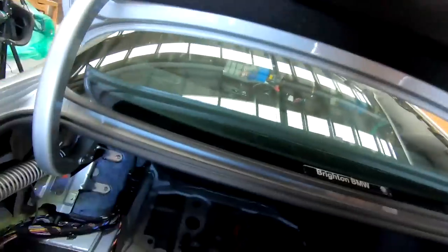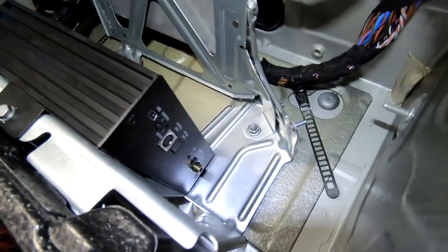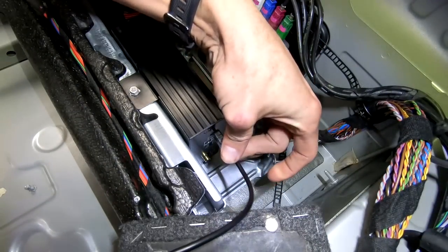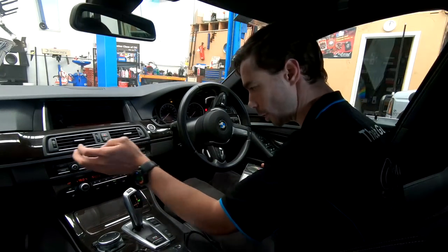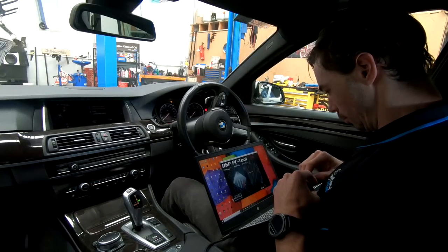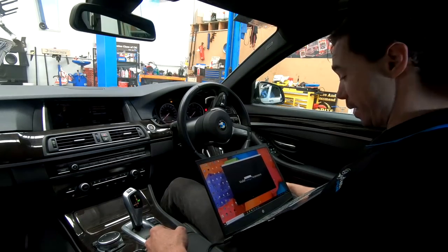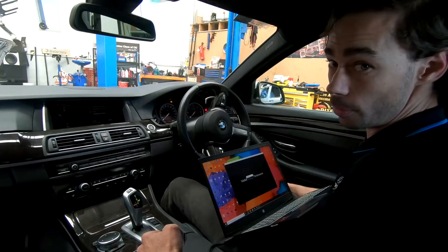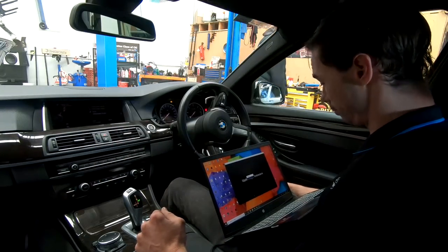Now it's time to get some tuning done. I've got to get the USB into our DSP, which is going to be down over this side, and feed the cable up to the front and get the laptop plugged in. Time to start doing some tuning. A quick little firmware update on the unit, which is all automatic, very nice. Basically, as soon as you open this software on the Match, it just goes, yep, you need new software, here it is, would you like it? Very user-friendly.